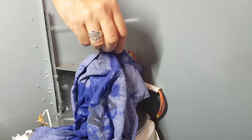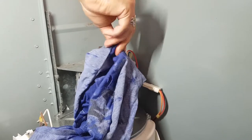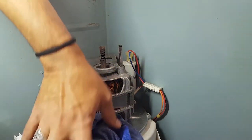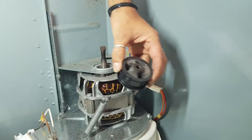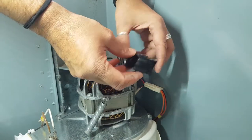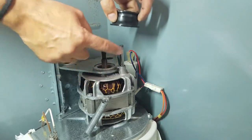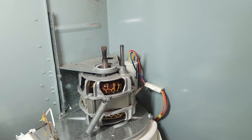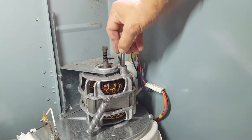By the way, I may as well tell you in this video, if you have a dryer that is squeaking, and you can't work out why it's got such a high-pitched squeal, this is the reason. Because the idler, if you have a look inside it, will get grooves inside the metal part that goes over this metal part, and that is what's making those high-pitched squeals, all right? But that's going to be explained in another video. Like I said, I'm going to be making that video. So that feels good to me. That feels very smooth.